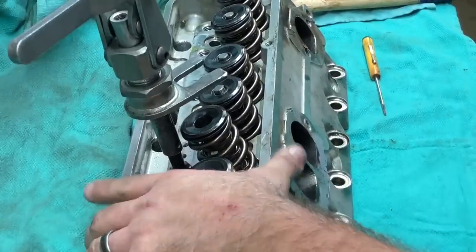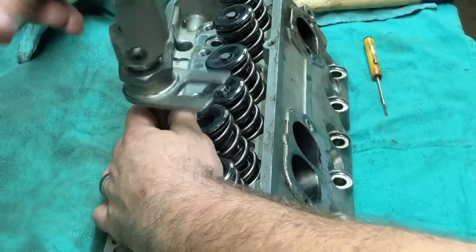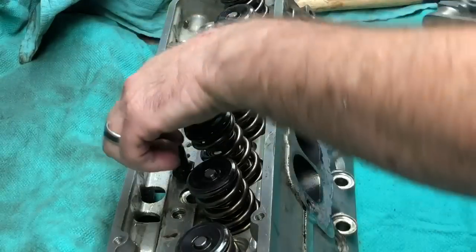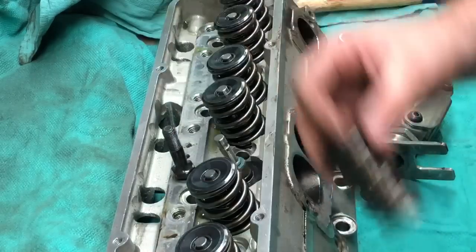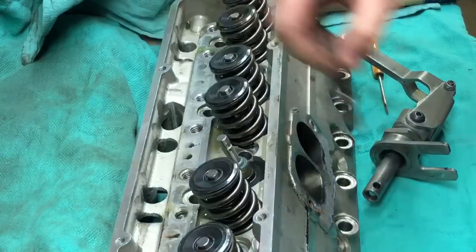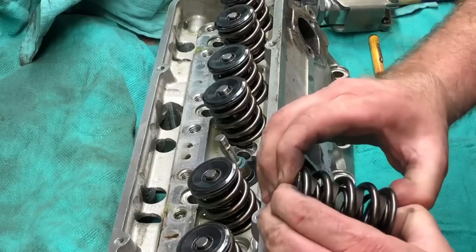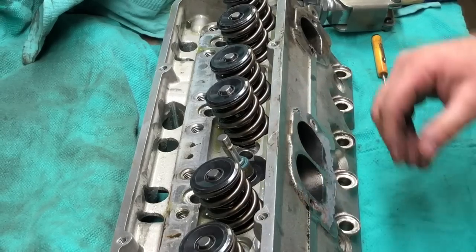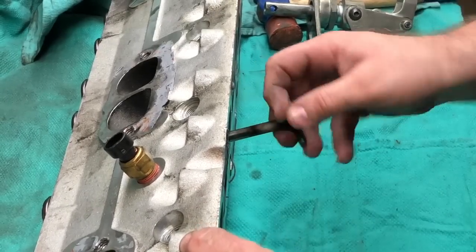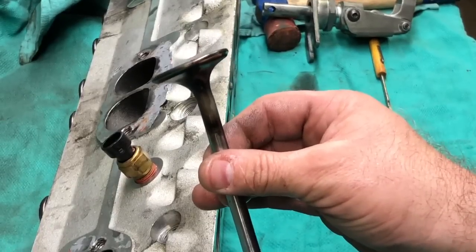It just grabs it just like that. Now I've got my two locks, and then you just carefully push up on it — and now this thing is apart, just that easy. A lot of people pay machine shops to do this, but like I said, I try to do a lot of my work ahead of time to help my machine shop guy out so he doesn't have to do quite as much — it just speeds up the process. Looking at the spring, this is just a dual spring — nothing wrong with the spring, locks are good. The valve is bad, so we'll pop that out. Luckily it's coming right out — it bent right there on the edge, and she is nice and bent.